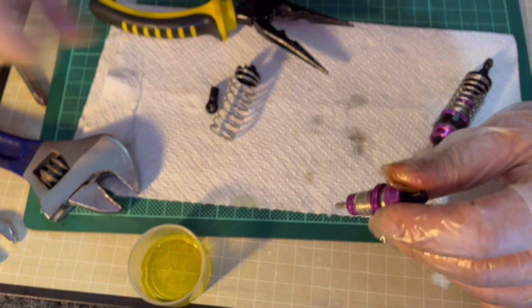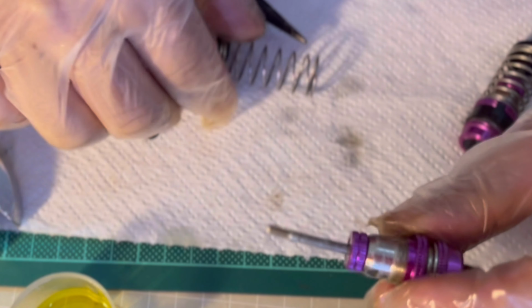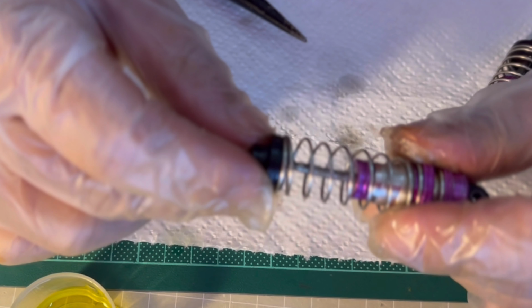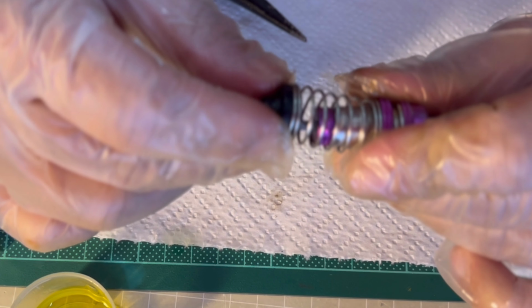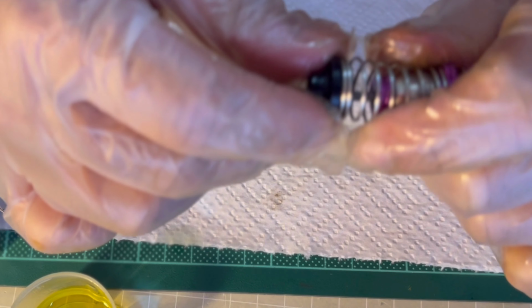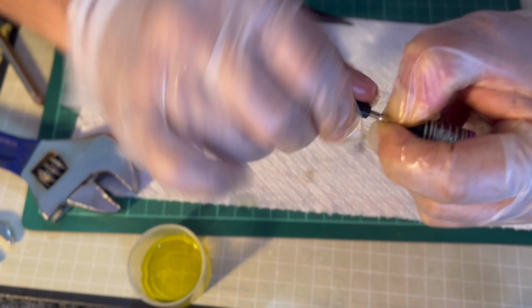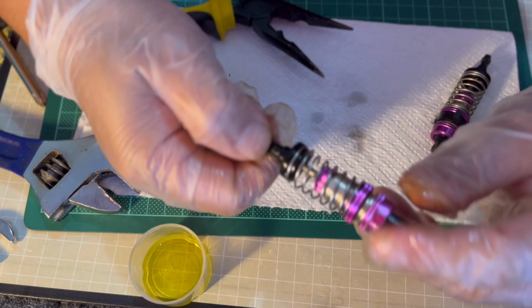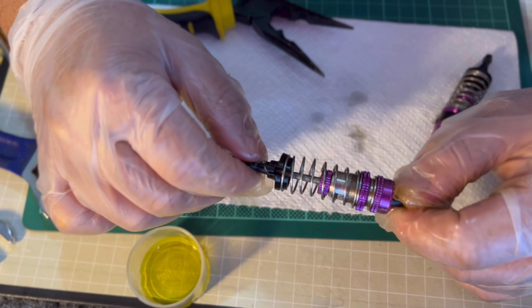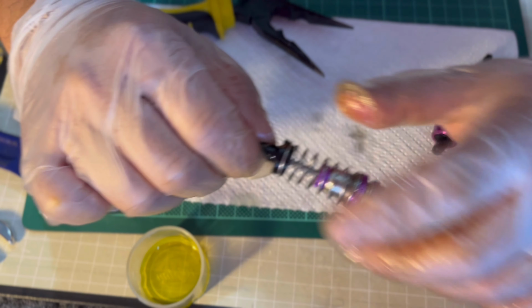So now we're ready to put the spring. This is the spring. You have to pull the shaft out, and you have to pull the chuck out there, the spring, together with the spring retainer. This one, and then you can put back this shock bottom. Now you'll see it's better and it's responsive, right? So we can put this back to the RC.